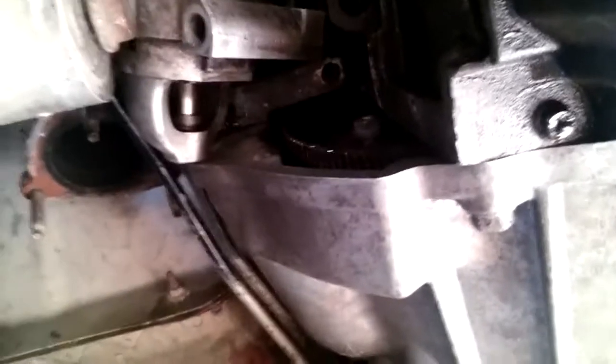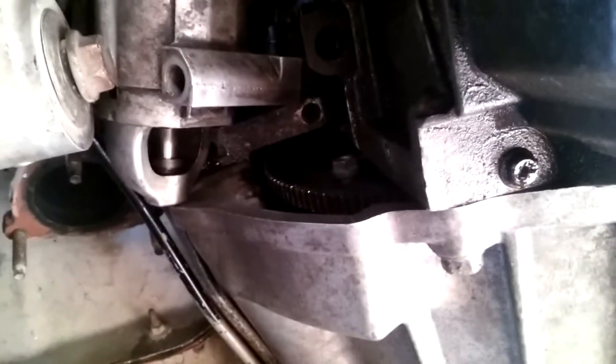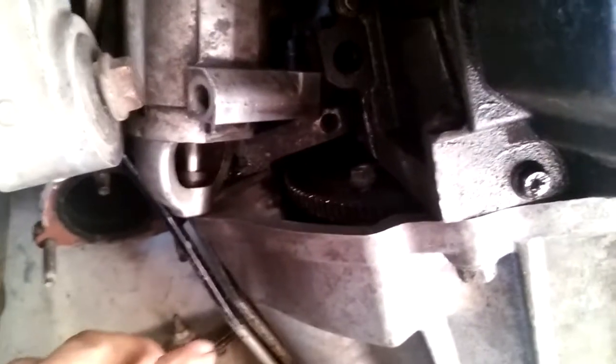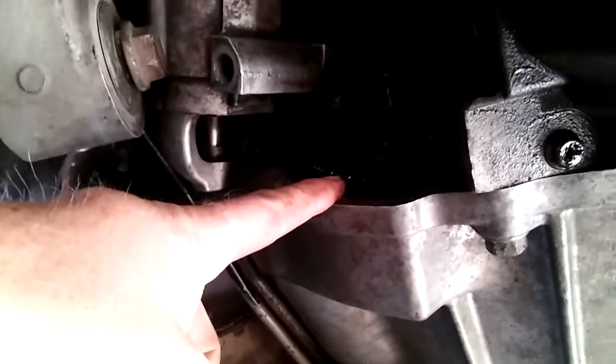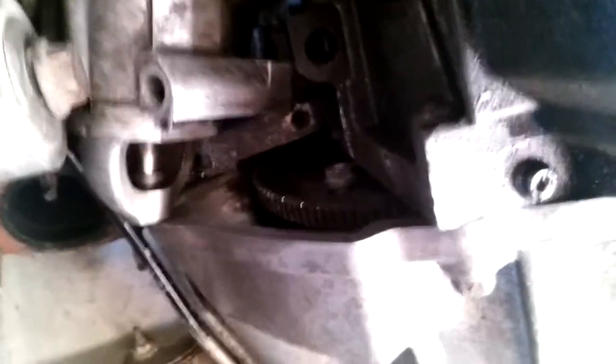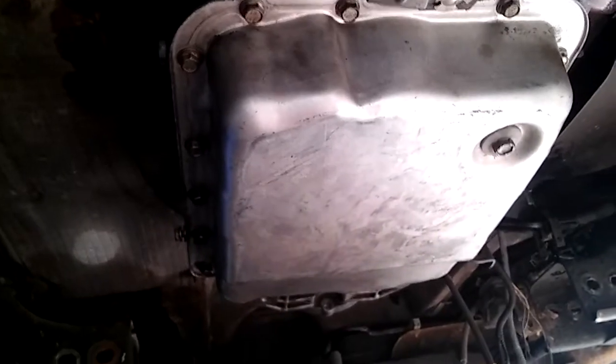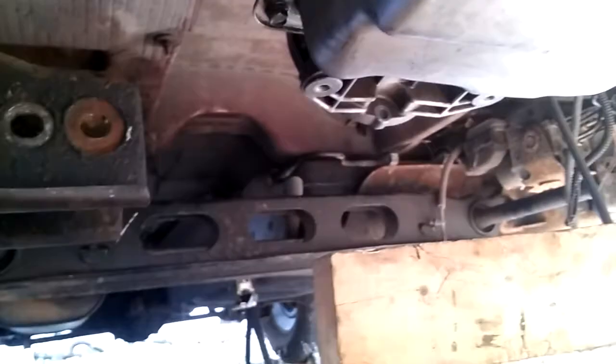The first thing is to get them almost all the way snug evenly. Once you've done that, turn the torque converter over about three times to get to each bolt — they'll be pretty much mostly tightened. Then take one at a time, pull it out, Loctite it, and put it back in. Loctite is cheap — better than having to redo it. Hopefully that helps. We're going to finish putting in this trans, and then we get to put the transfer case in too.